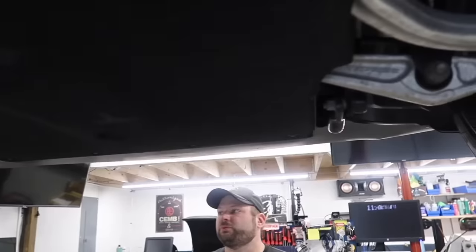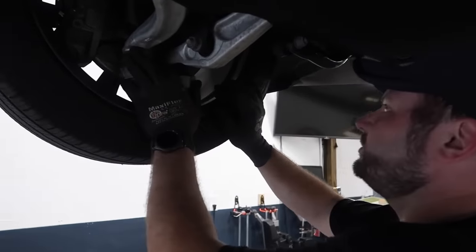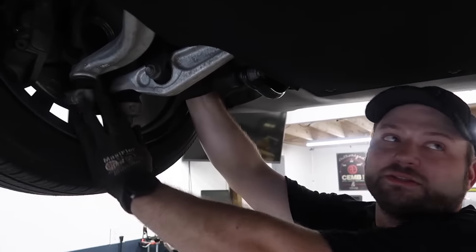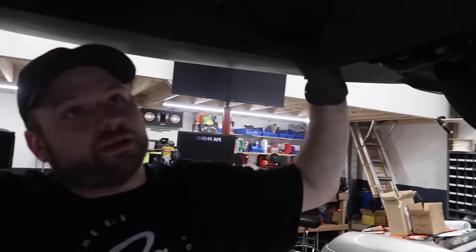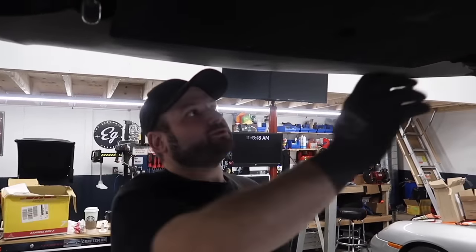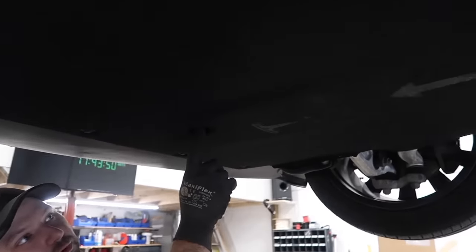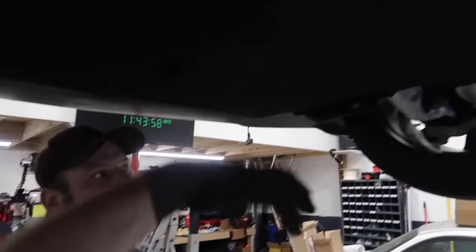So what we're doing now is going through the suspension — check the sway bar, ball joints, and tie rod ends on both sides. Also the belly pans. A lot of times there's loose hardware and we found some — this bolt right here is kind of halfway in. Going down the road, the wind's going to be buffeting it and it'll be annoying.